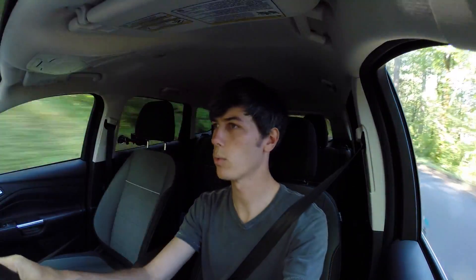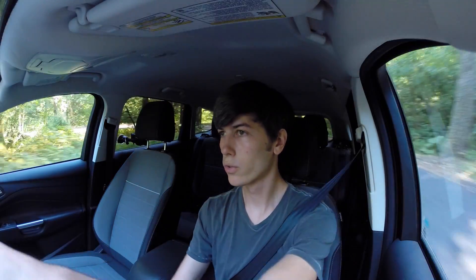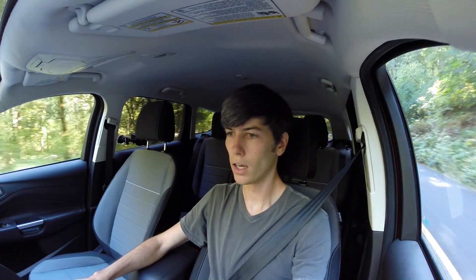The vehicle handles pretty well on windy roads. You may notice a little torque steer when you press the accelerator all the way down — this can happen with front-wheel drive cars that have decent power, where the steering wheel tries to turn itself under hard throttle. If you hold the steering wheel firmly while accelerating you shouldn't notice it too much. You can also switch to manual shifting, which is useful mainly for engine braking going downhill, as you won't get the response of a DCT or similar transmission.